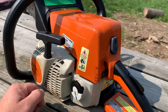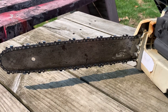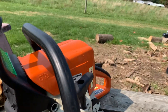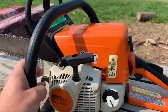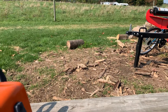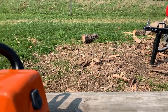And this thing just started right up — it actually runs pretty good. I did have to get the chain resharpened because it was kind of damaged from probably hitting nails and stuff on a construction job. I got it cleaned up, sharpened, and fixed the chain. When I got it into some wood cutting small cookies, I noticed I had to do a little tuning because when I took the spark plug out it was white — it had been running lean at high end. So I retuned it in the wood to where it had a little more power and more fuel at high end when running hard.